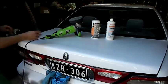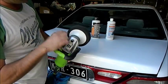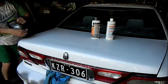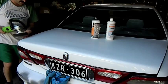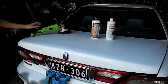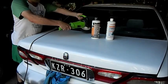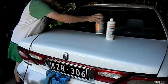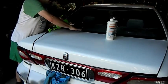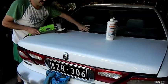When you use the buffer, be mindful of the direction of rotation. It's a slow-starting tool — we're going this way so that when we come off panels we hold it so it's running off the edge. If we put it on the wrong way it's going to burn through that edge and mess up our work. So keep in mind the direction of rotation — come across this way because it's going this way and it's coming off that edge. If it hits the window it doesn't burn it, but there's a rubber strip there we don't want to hit because it's going to burn.